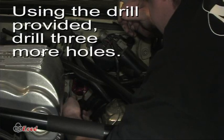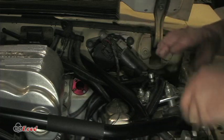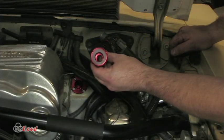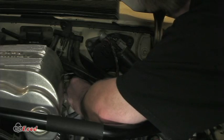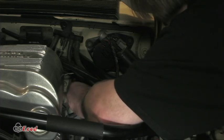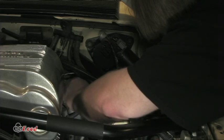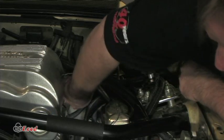What we're doing right now is installing the click adjuster to the firewall. We've pulled the cable out, pulled the rubber grommet out, and now he's installing the first part of the click adjuster. This is what we'll use to adjust the master cylinder — to get the free play out of the cable and also adjust our pedal height. Now that you've got your base mounted to the firewall, we're going to go ahead and put on the other part: the sleeve with the nylon bushing in it. This is what the master cylinder will sit in. The master cylinder does not bolt in — it just sits in this pocket, just like a ball joint. When you first put this in, you want to adjust it all the way in to the stop. This will allow you to have free play in the cable when you stick the master cylinder through to hook it up to your quadrant.